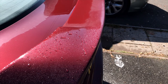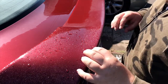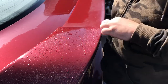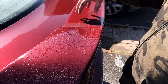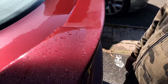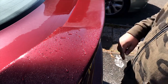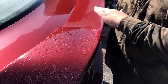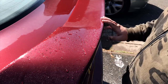This is a good time to point out something many will know but some won't — just because a car beads water, it does not mean it's protected. This area was treated with compound and this area had nothing done to it — that's been compounded, that's been nothing. There's no protection on it whatsoever, it's just clean. So a car can bead with no protection at all; it's been compounded back and you'll still get the same water reaction as a car that's been waxed or sealed. Remember that.